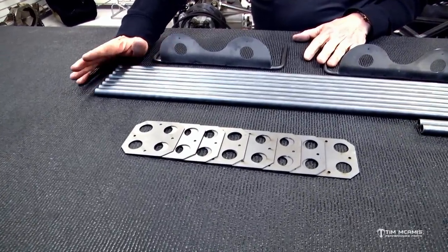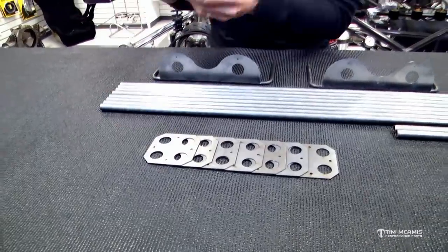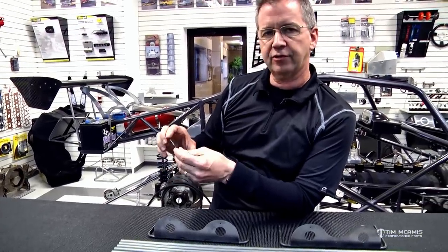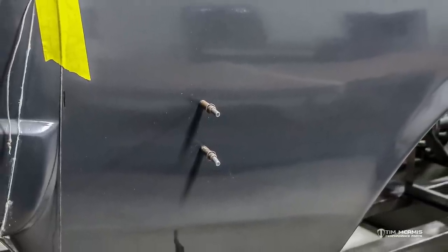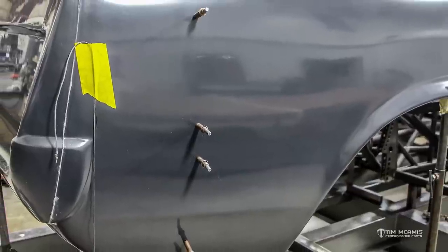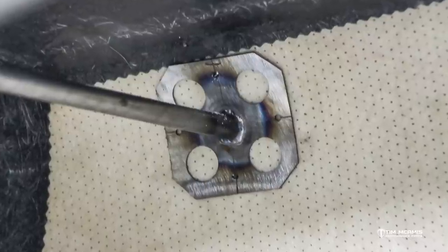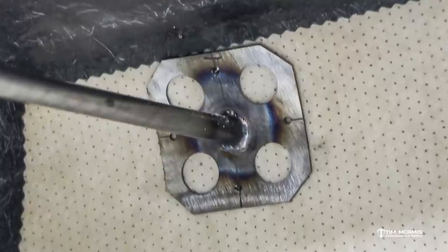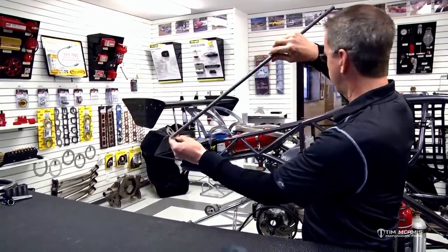One is a standard kit which would — just to give you a brief rundown — these plates, the holes in here, you would drill and cleco these to the body. The clecos are those little removable spring-loaded bits that go in with a pair of pliers and that expands and locks this in so you can drill an eighth inch hole. You can fasten these on the inside of the body at the back and at the front of the quarter, and then from the chassis to the tube you would fit this and then weld that to the center of that plate.